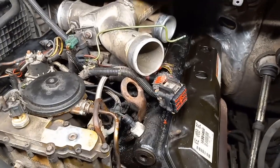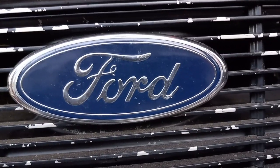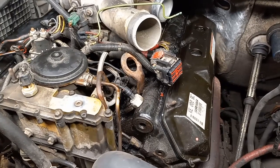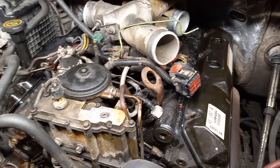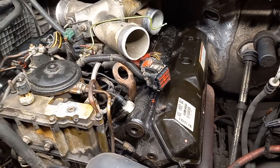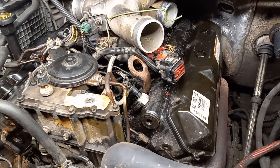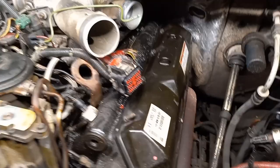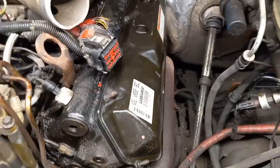For those of you who have been following along with us since the beginning, you might have seen that we had an issue with this truck. It's a 99 F250 with a 7.3 diesel in it. They're pretty reliable but they do have some shortcomings. One of the things you've got to do on these every couple hundred thousand miles is change the injector o-rings, which all together is not that big of a deal. It is a pretty fair amount of disassembly on the engine, but as far as getting to the injectors it's pretty easy. You're basically getting to your valve covers and then removing everything around them on both sides.